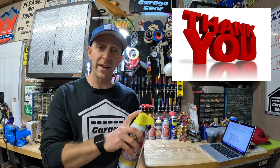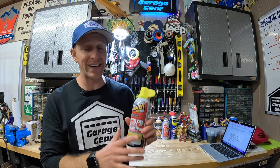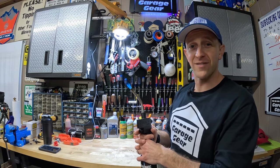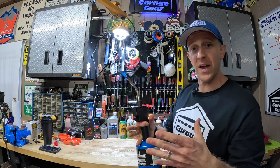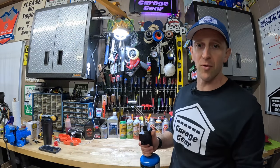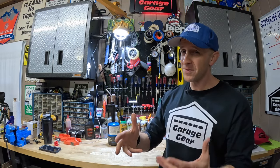Now, what if your wheels just aren't coming off? Here are a few things I've done in the past with varying levels of success. If your wheels are really stuck on, spray them down heavily with PB Blaster — let it soak overnight, because this is a product that needs time to do its job. Come back the next day, give it a few taps with a hammer, and it should come free. The next thing you could try is torching it — heating that wheel up should create some expansion and allow it to break free from the axle. Be careful using heat though; it could ruin any paint and could ignite any gas nearby. Right after heating it up, dump some ice water on it — the rapid expansion and contraction could help break the bond. I've done this a few times and you actually hear a loud clink when the metal bonds break.